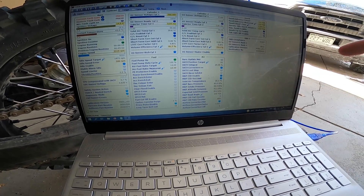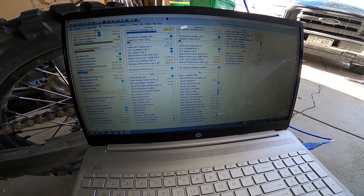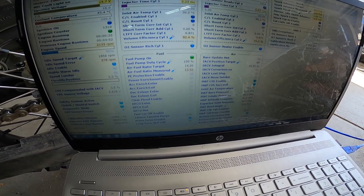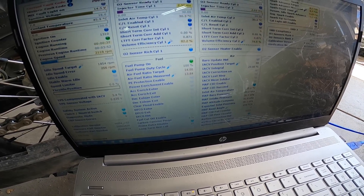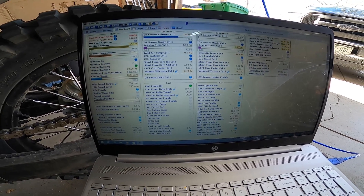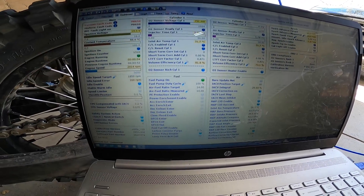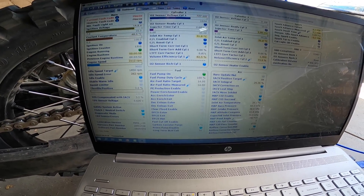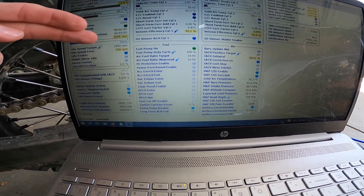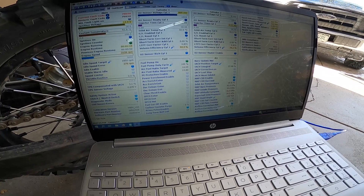It went into closed loop, probably because the engine's already warm, but just to show you this mode is still closed-loop mode. It's kind of looking similar just yet — now it goes up to 14. But notice that when I rev the bike, it's lowering my AFR based on the RPMs. Everything else in here is really looking the same, almost identical, but the logic it's using to fuel the bike is wildly different. My closed-loop is still enabled. The way I have the map set up right now, it's not between cells for my RPM, so it's just keeping it a steady 14. If you have this set up where you're between cells — like the next cell down is 13.8 — and your RPMs are going between those two, it will average out an AFR there and kind of go between them.